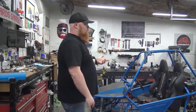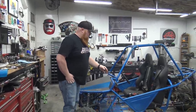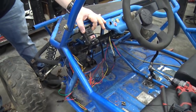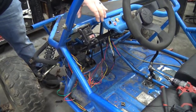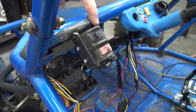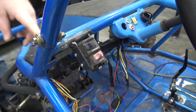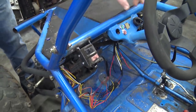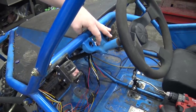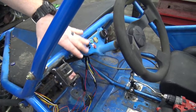Unfortunately it ain't going to be here until tomorrow or the next day. But we did wire up — if my lovely assistant will come over here — we did wire up this original four-wheeler little switch that went on the handlebars. I just took two pieces of flat stock, drilled some holes, screwed them on, and that blocks the hole so water won't get inside, and we'll fill that up with some type of silicone. So we have a key switch, a new four-wheeler key switch. We've got a reverse and neutral light — it is in neutral right now, I just haven't hooked up these lights.